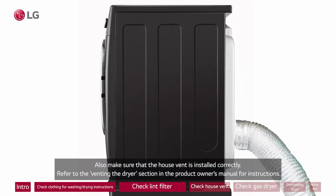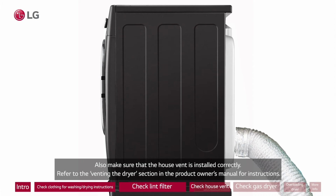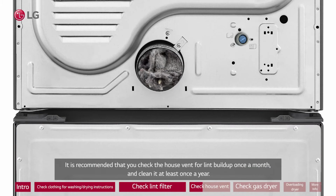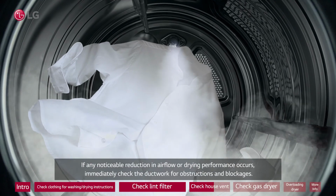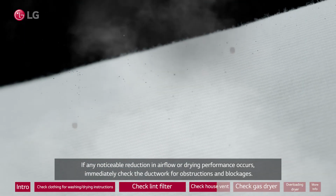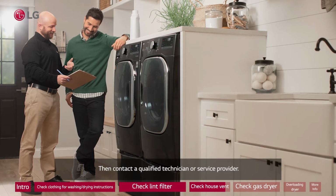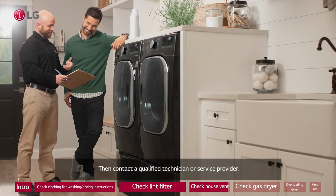Also make sure that the house vent is installed correctly. Refer to the Venting the Dryer section in the product owner's manual for instructions. It is recommended that you check the house vent for lint buildup once a month and clean it at least once a year. If any noticeable reduction in airflow or drying performance occurs, immediately check the ductwork for obstructions and blockages. Then contact a qualified technician or service provider.